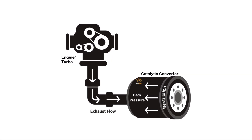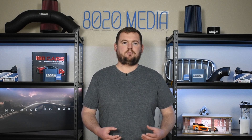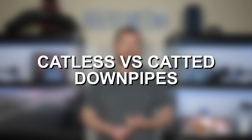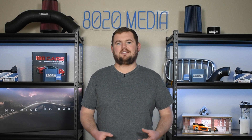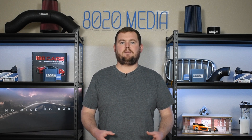Reducing back pressure is safe and healthy for the engine since getting air in and out efficiently is very important. Getting that air out efficiently is what allows the turbocharger to spool faster and build more boost, which is where a lot of the power gains really come from. There are a couple of considerations when it comes to downpipe upgrades: catless versus high-flow catted downpipes. A catless downpipe is illegal for the streets but offers the biggest power gains, while a high-flow catted downpipe offers slightly lower power gains but is easier to pass emissions testing. It just depends on what you're looking for.